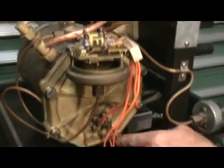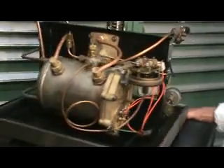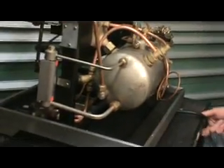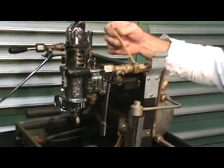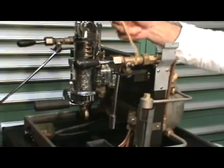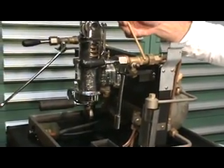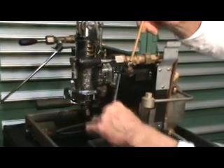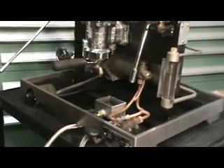This has got a dual element and runs 1,350 watts. The over-engineering aspect of this is that each one of these valves is extremely adjustable throughout the range. In each valve, if La San Marco could do it with one spring, they decided they'd use two springs. There's a spring in the front which controls the tightness and sensitivity, and there's a spring in the back that controls the valve. And once again, another spring here which controls the tightness of these levers — and the same thing down in here. There are multiple springs in this water valve that go in both directions. This uses a lot of Teflon seals.